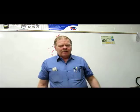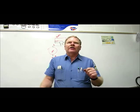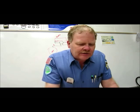Two technicians are discussing torque wrenches. Technician A says the torque wrench is capable of tightening a fastener with more torque than a conventional breaker bar or ratchet. Technician B says the torque wrench should be calibrated regularly for the most accurate results. Who's right about that? B. Obviously B. Don't ever use a torque wrench for a breaker bar just to break something. It's really a sort of a delicate tool. You're not supposed to go crazy with it like that.